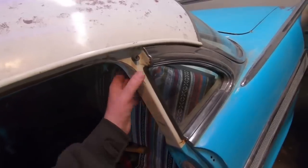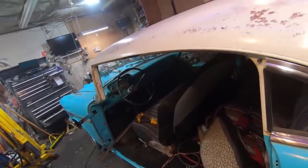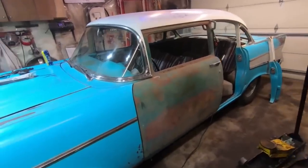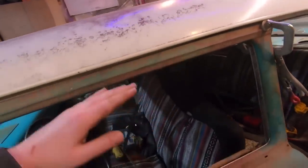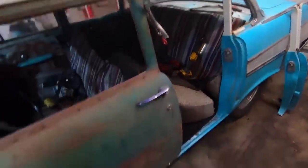I've got to get in there and take this piece of glass out and some of the moldings out. That's a fair bit of progress in an hour — you can sure mangle something up pretty quick. My fender gap is pretty good, and the gap around here is pretty good, but I'm real tight here. If I drop the door just a little, I should be able to open that up. It's kind of a two-man job, but I just got it clamped together. And as you can see, where I cut out the post is actually hidden by the door.